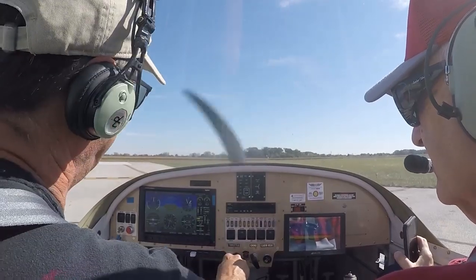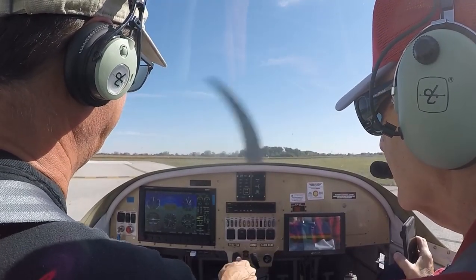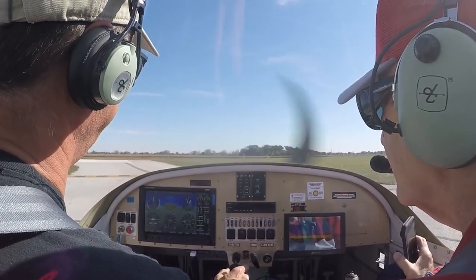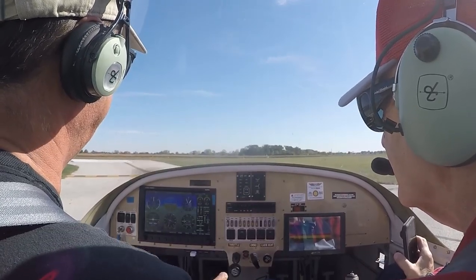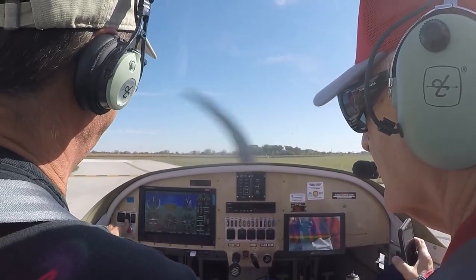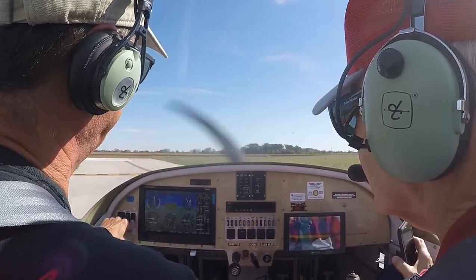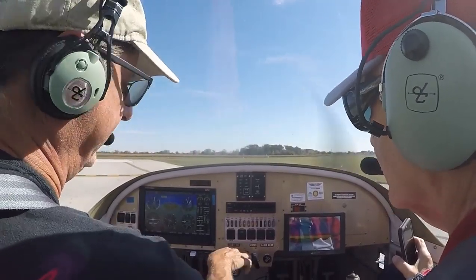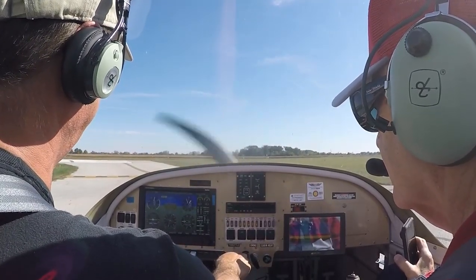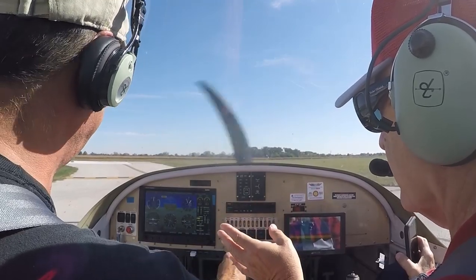This airplane would fly on one magneto, but you've given up your redundancy — there's absolutely no reason to ever do that. So we're going to rev it up. You can push it in and fine-tune it with the vernier. I'm going to turn off the left — we dropped about 190, 170, somewhere around there. It's going to come back up, and then we should see the same thing with this one. If nothing happens, your ground is broken — that's bad news because you really want to be able to turn off those magnetos. Then we bring it down and make sure it'll idle. Both magnetos are back on.